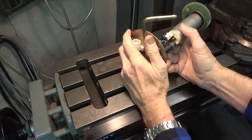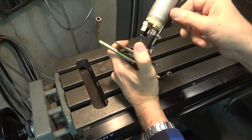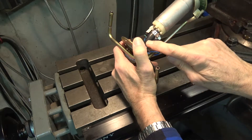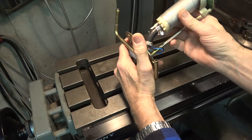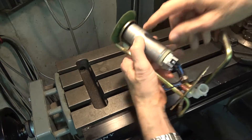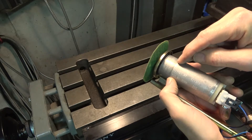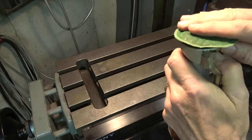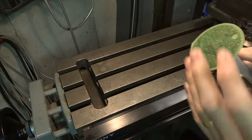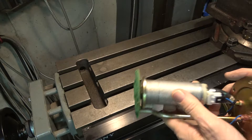I've assembled the gas pump back into its frame — this is just a slip-in electrical connector. As it turns out, the replacement pump was just a little bit taller than the original, and I had to trim off this hose just a bit. With that, it went in okay. I put the rubber vibration mount at the bottom, between the pump and the holder, then pressed on the filter that goes at the bottom. This keeps junk from coming up out of the gas tank into the pump and jamming things up.